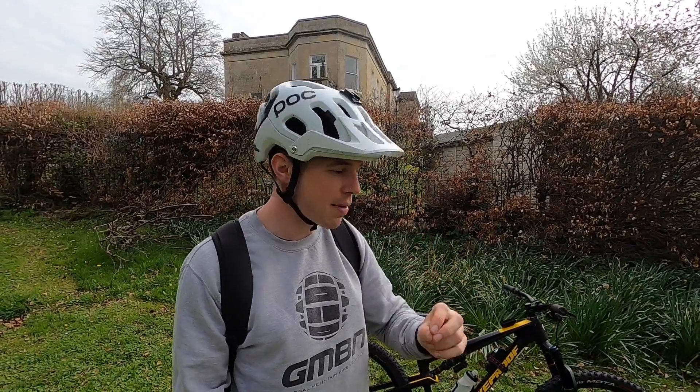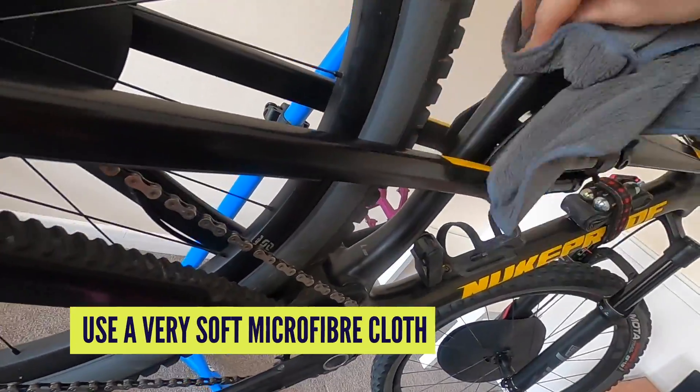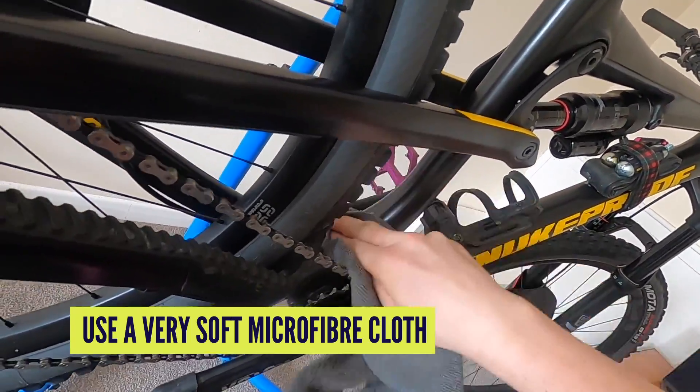So onto the frame detailing itself. For something to be shiny, it needs to be really efficient at reflecting light, meaning it's very smooth — no peaks and troughs. What you're doing when you're polishing, on a very micro level, is filling in those small gaps, those small scratches. Not only will it reduce the appearance of scratches, you're also changing that top layer of paint on a really micro level. You need a good polish but also a very soft microfibre cloth. Don't use paper towel or kitchen roll because even on a small level they could be scratching or deteriorating the quality of your paintwork. A nice soft cloth is absolutely vital.